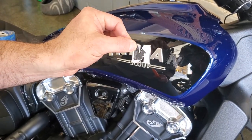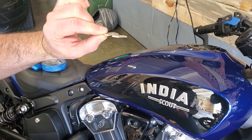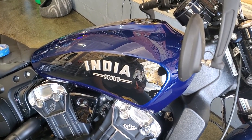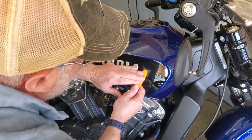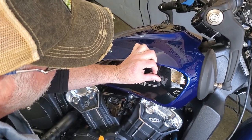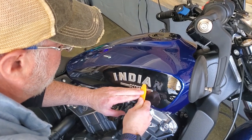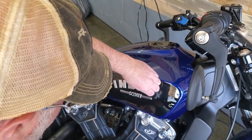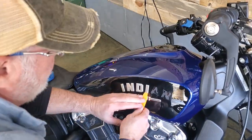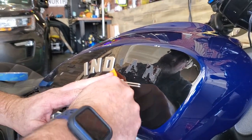It's pretty thick because these are hollow — just like a stamped piece of tin, really malleable. So you can bend them and wrench them and do whatever. You can just continue to scrape it — it's kind of a pain. But warming it up helped a little bit, just softens it up. Your typical car emblems aren't hollow on the back so the adhesive is a lot thinner and it's a different kind of foam. This is really, really thick dense foam that doesn't want to come up, so it takes a little bit longer.